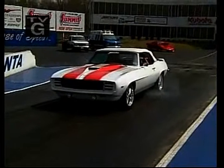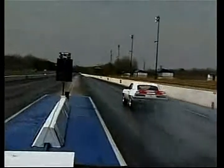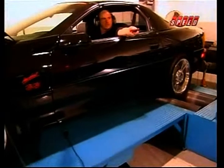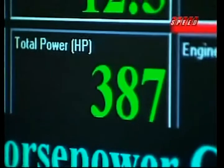Muscle cars do tend to spend a lot of time with a pedal to the metal, so it's important to know what's going on right then. And what exactly is this thing called a throttle anyway? First of all, if you had no throttle and you started the engine, what would it do? If it had a carburetor with no throttle in it, the thing would fire up and run away because the full air density going into the engine is unrestricted.